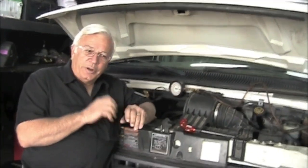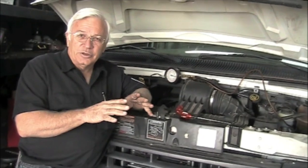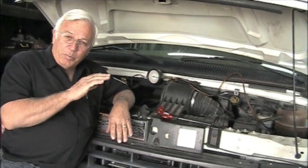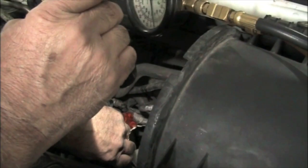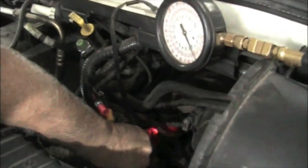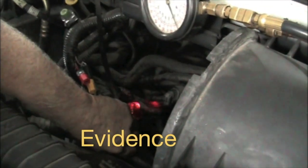Looks like everything's working. If you power that fuel injector and you're squirting fuel into the cylinder, you don't want to do that for long and overload the cylinder with fuel. Now we should be able to start the engine — it will pump that fuel out through the cylinder. We go back and use our vibration tester to see if the injector's pintle is now working. The vehicle is running smooth. I've got my tester on the injector and the light is firing. When I pull it away, the light goes out. Put it back on — confirmed.